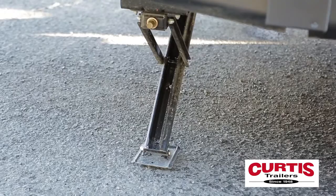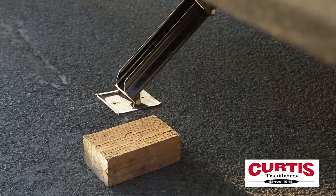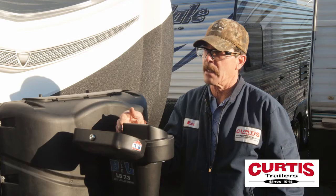It drops it down in the front to get below level or closer to level, because you would have been high when you unhooked from the truck. At this point, it's running the rear leveling jacks just behind the axle. The right side will come down and touch because it's on the higher side. Then the left side will go down, leveling the trailer from left to right.